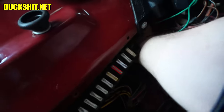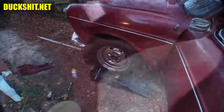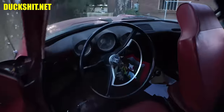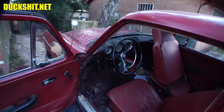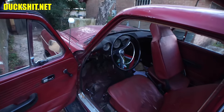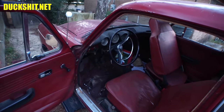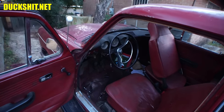I am not a fan of getting up underneath this dashboard on this car because I am just entirely too big. I am going to put some of that cable back down under the car and try to route it around these wires, and hopefully get it up on the back side of this speedometer. I can tell already I am not happy. The speedometer is all together again, and I spun the wheel up. I don't think I can spin it quite fast enough to get a reading on the speedometer, because technically when it's at zero it's actually pointing at 10 — that's the way it's designed. While I was dicking around underneath there, I decided I was going to replace some speedometer bulbs because some of them have failed, and I discovered that was a total cluster.